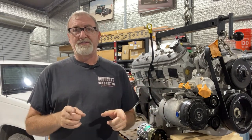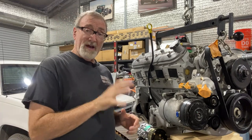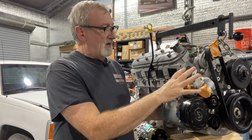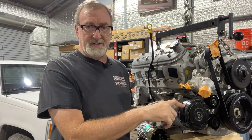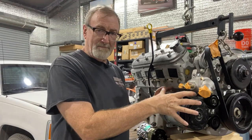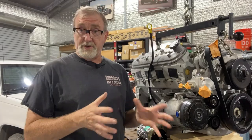In the new mounts, we also want to make them reproducible — so stay tuned for that. Back to the AC compressor: I'm going to take all this off. First, I've got to take the tension off the serpentine belt to get the main belt off, then take the separate air conditioning belt off. Then we can access all the bolts, drop all the Corvette parts, and when I get them all off, we'll put them next to the Sanden parts and show you the difference.